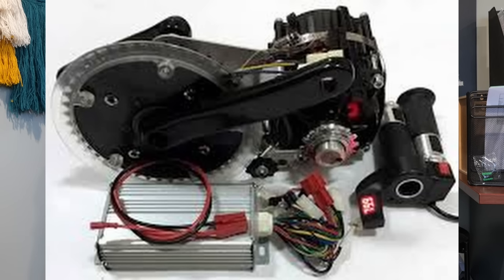Now, on the fringe side of the motors, they have like the Cyclone motor, which often gets confused with the CYC. Cyclone is totally different than CYC. I've made many videos on it. I have a love-hate relationship with it, but I've actually discontinued carrying the Cyclone motor, much like almost every other reseller out there, because of so many install issues, people having trouble hooking it up, getting it to run correctly, things like that, and very little support from Cyclone. But they're great if you just need brute power and for cheap. That thing will handle 4,000 watts for fairly cheap, for like $500 or less.